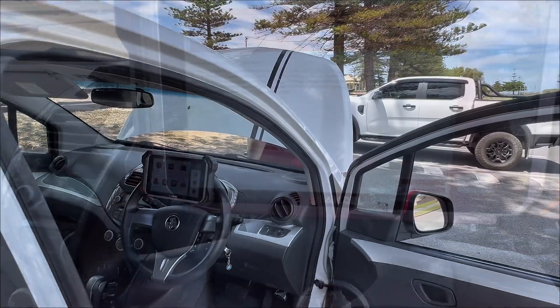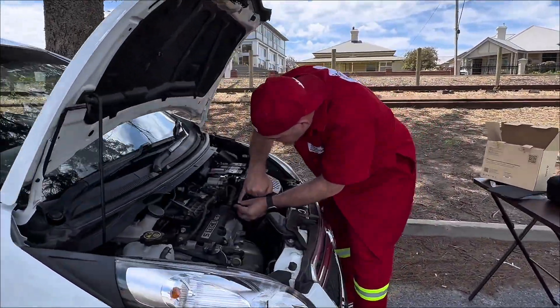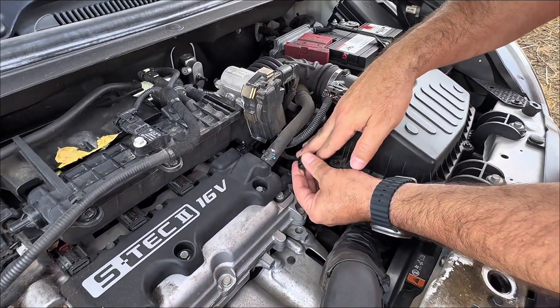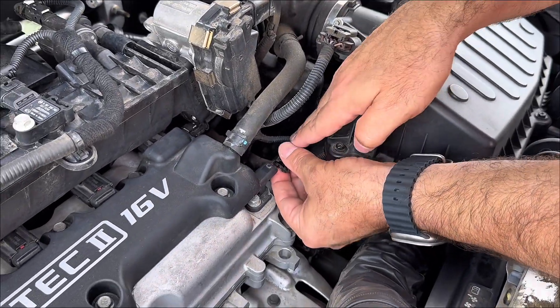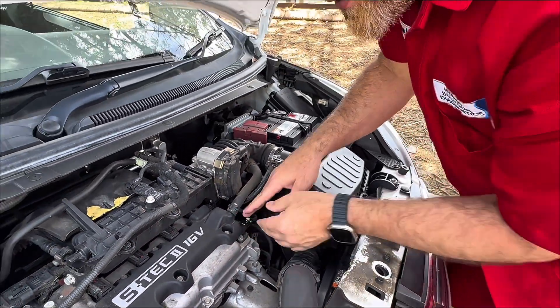I'm not sure what's going on, but let me check. The first thing I'm going to do is a visual inspection of the camshaft position sensor bank B. I think I found the problem — come on over and check it out. The sensor had a little bent pin over here, probably making a false contact. You can see the engine is a little dirty, so probably somebody was doing some sort of service here. I've just pulled it in and I don't see any bent pins on the sensor now. Let me just try to secure it.